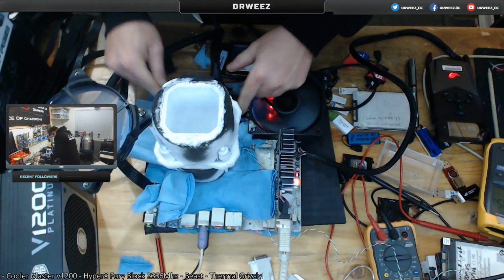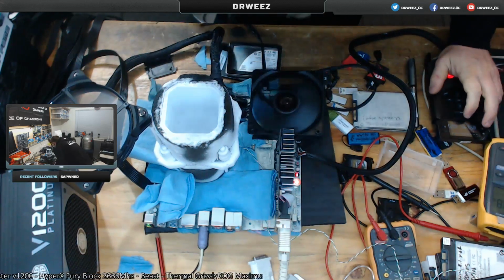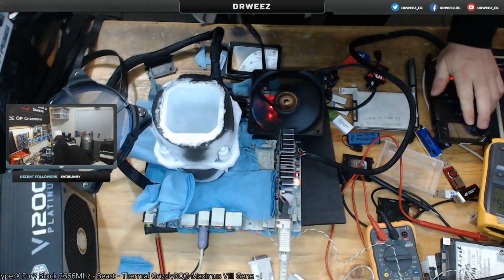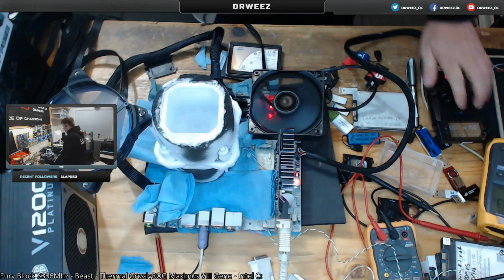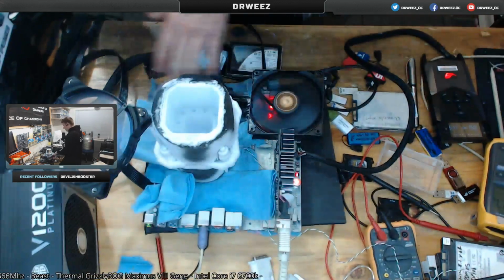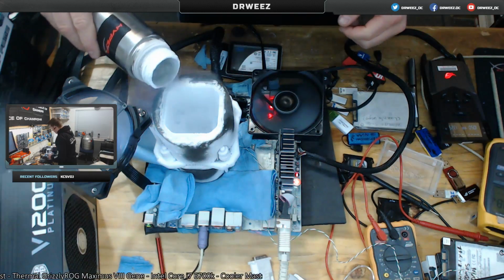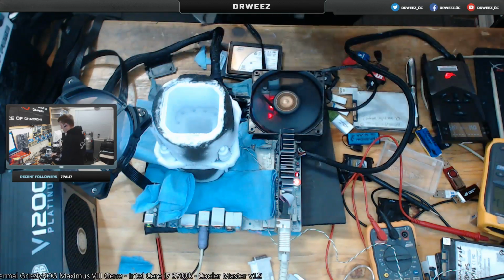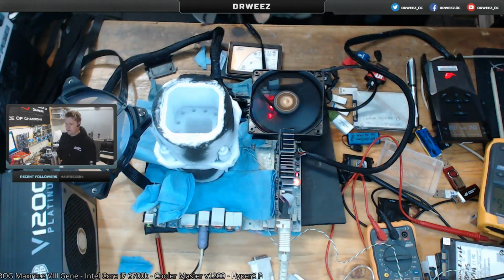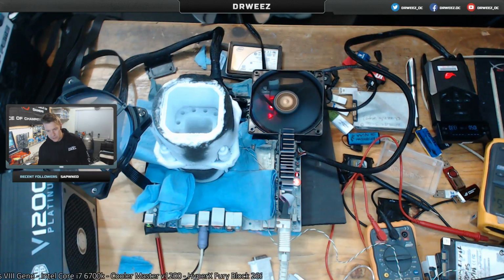Alright, so we've got... okay, I'm going to go ahead and just do a run now and save a score, because I think we might actually end up with some issues. Surprisingly, on the memory, there's a fair amount of frost. It's really different benching in this climate from benching in summer here. You've really got to start taking different precautions. In summer, you're crazy to put too much paper and stuff over your memory. You just need to catch it at the bottom. Now in winter, everything wants to freeze over so much quicker. And if you notice the ice build-up around the pot shells, it's hard to explain. It's almost as if it's harder and smaller rather than bigger and fluffier, if that makes any sense to an overclocker. It's such a drastic extreme from summer to winter here in Johannesburg.